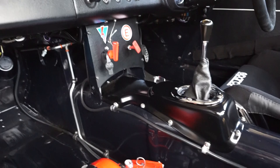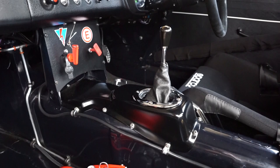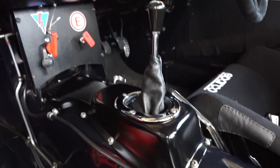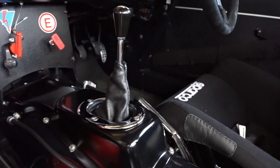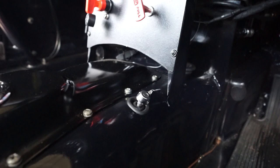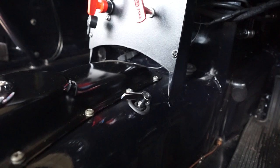The gearbox in the car is a four-synchro. Originally the early cars would have had a three-synchro, but a decision was made to allow us to run four-synchros in UK racing basically because there was no availability of the three-synchro gear sets. This is a slightly custom cover made by Clark and Clark in the USA out of fiberglass - the idea being that to get the four-synchro gearbox into the earlier shell it has to come back a bit, and this cover allows the gear stick to sit nicely in the car. There's also a little lever that winds in the detent spring for reverse, allowing you to lock out reverse so you don't select it accidentally when racing.